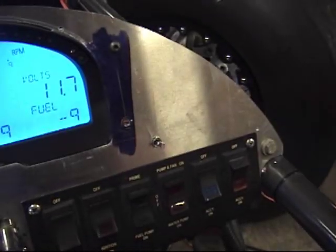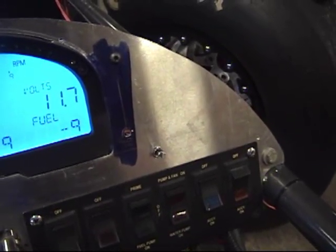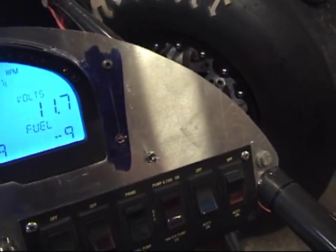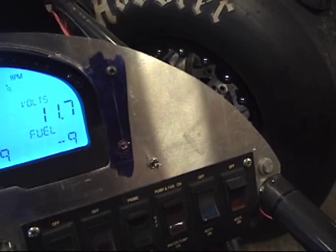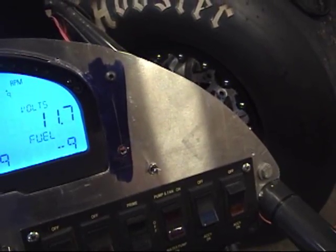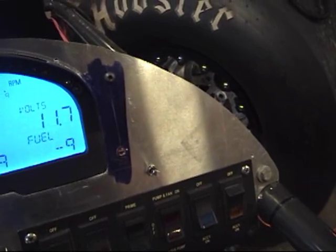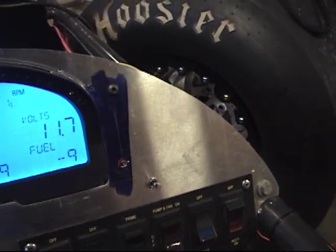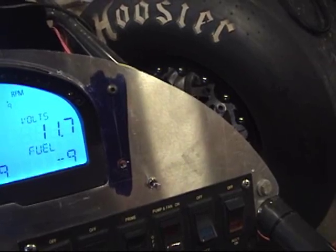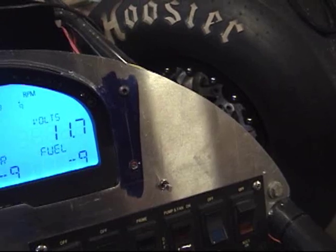In a typical IQ3 installation there would be two momentary push buttons — button one and button two — to do various programming tasks. One of which is the backlight that we would use in drag racing, and another one is changing screens. To make it a cooler installation, I've selected a momentary toggle switch that's dual pole, which will actually be both buttons for our installation.